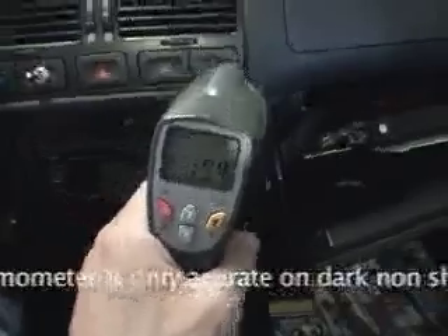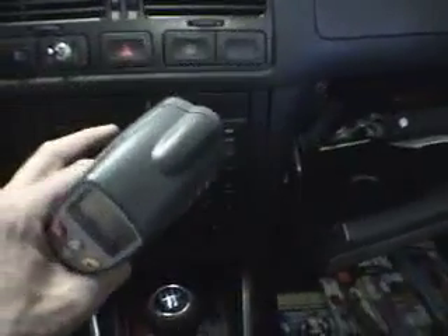Another way to double-check is with a spot infrared temperature gun. I bought this on Amazon for about 40 bucks — it has a laser guide. That helps me verify whether the temperature is actually correct. In a nutshell, what I'd highly recommend is adding that on/off switch for the Vegetherm and also the temperature gauge as a default safety failsafe to know the system is up and running.